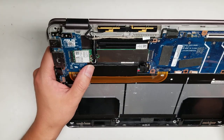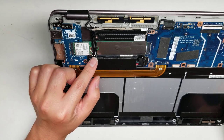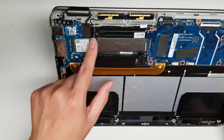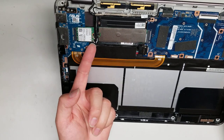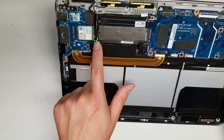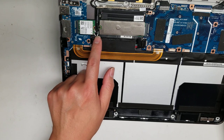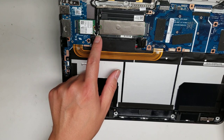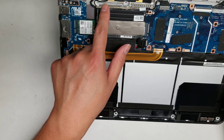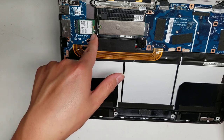The wireless card antennas look kind of tough to remove. You'll have to guide the antenna wire out first — usually you'd lift it from the tail, but the tail is held in place by a part that overhangs the wire. So you have to undo the wiring from this side first, and then when you have more slack you can pull up the antenna at an angle from the tail. Don't try to pry it from the front or you'll damage them.